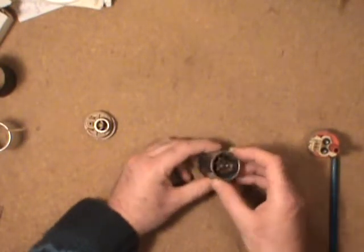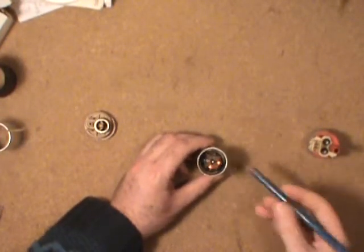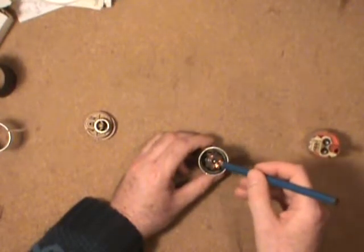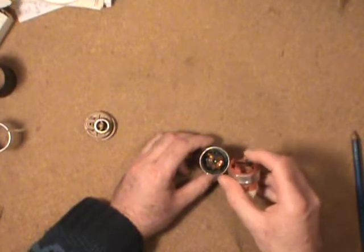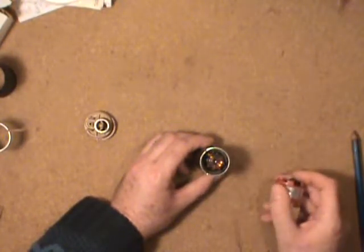Now there are two really strong magnets in here — it's a DC motor. There's a copper commutator with several segments in it, and that's where the brushes supply the electricity into the armature of the motor itself.